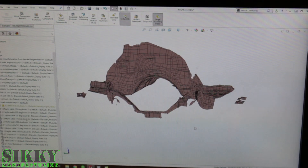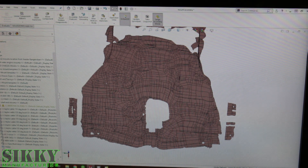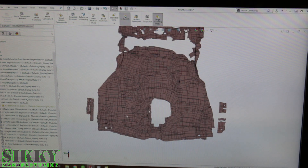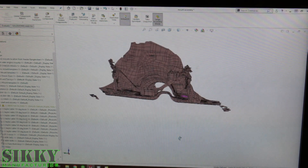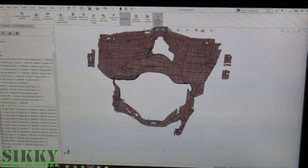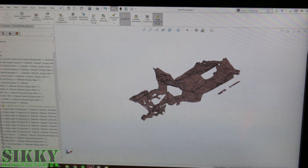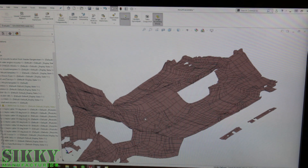There are several challenges to the design of this mount kit that we're going to have to overcome from the scan data. The trans cross member itself is going to be massive — it's probably roughly five feet, spanning from this frame rail all the way over to the other frame rail. We're going to make it as lightweight as possible, but it also has to be extremely rigid and strong. Some of the other challenges are going to be fitting this engine in there as far back as we can. We have to take into account customers that want to run air conditioning — that's the only limitation for how far back we can push it. We could go further back into the firewall, but then we're also going to run into challenges with the shifter and where that's going to come out, so finding that happy medium is important.